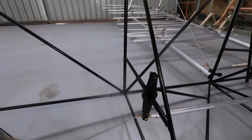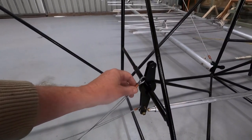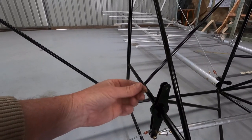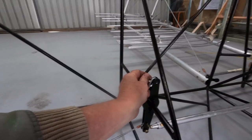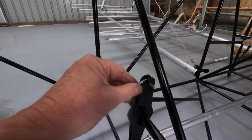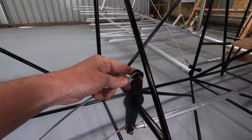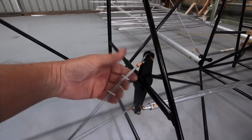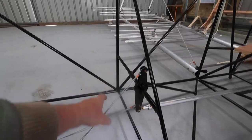On the bell crank itself, it's got a bolt running through there. It slips in. I've ordered some bushes — quarter-inch, 3/16th ID — for the AN3 bolt. It'll just give the cable something to wear on. I can do this bolt up tight. It's too long, I know, but it'll do for purposes of the trial fit.